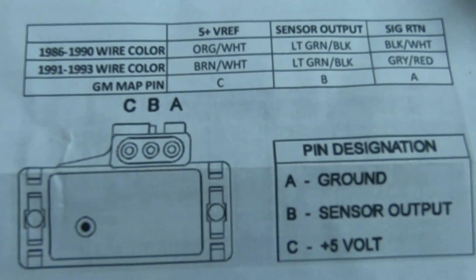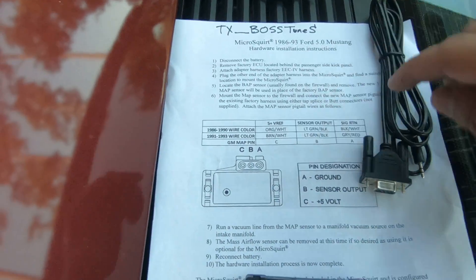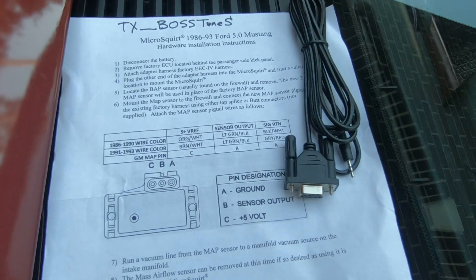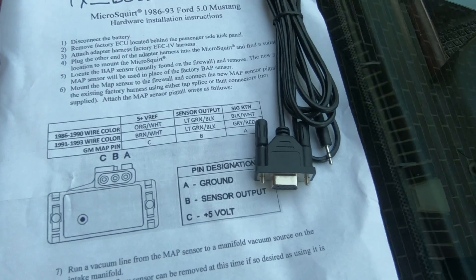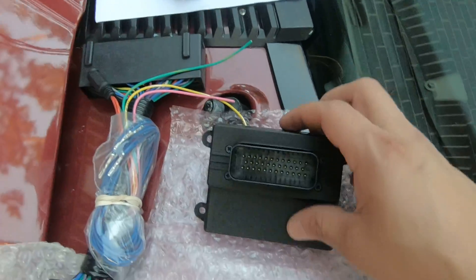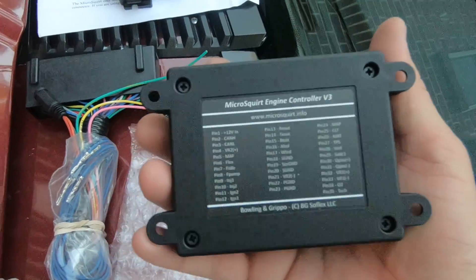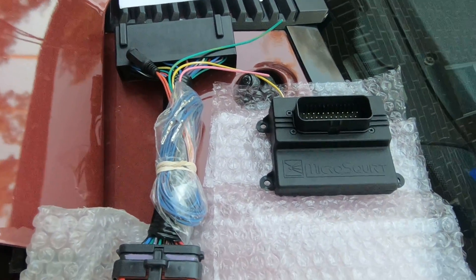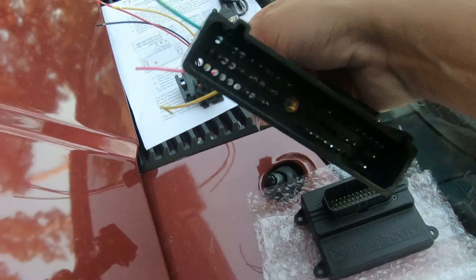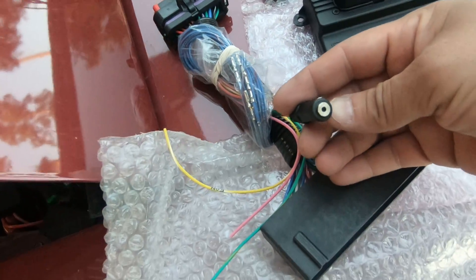All the wiring pins are here — I'll show you in a second how mine is set up. You've got a serial connection to the micro, and this side connects to your laptop. If you don't have a serial port on your laptop, you'll want to get an adapter that goes from DB9 to USB. Here we've got the Micro Squirt — it's not a large ECU like you've got on your Fox Mustangs, but it is a plug-and-play system. This connector here goes right into the micro and this side goes into your stock harness.